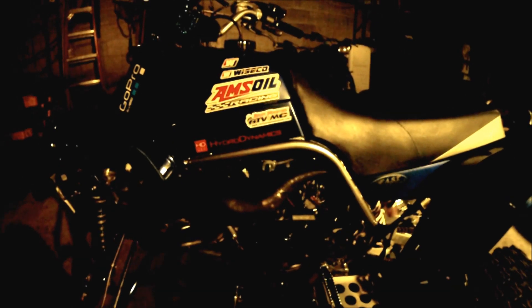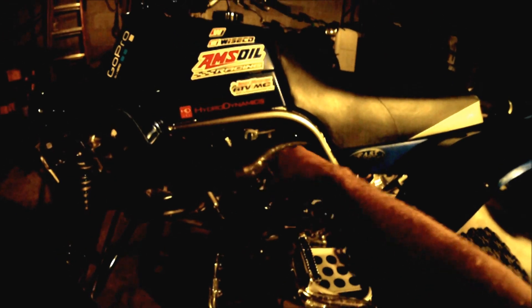So if you jet the bike to run at 40-to-1, make sure you run it at 40-to-1. First of all, make sure that there is fuel in it, make sure the fuel is on, and make sure your fuel vent isn't clogged. If your bike won't run and you think it's not getting fuel, there could be a vacuum in the gas tank because your vent's clogged and air can't come in to replace the fuel. If you crack your fuel cap open and it runs fine, you know you have a clogged fuel cap vent and need a new one.